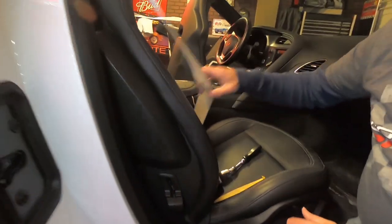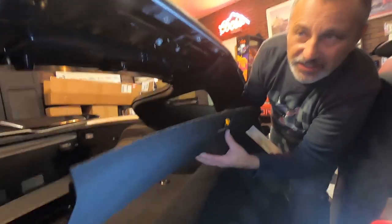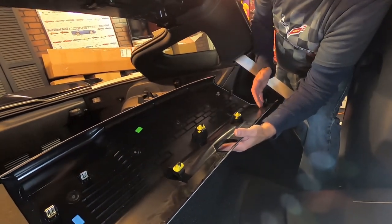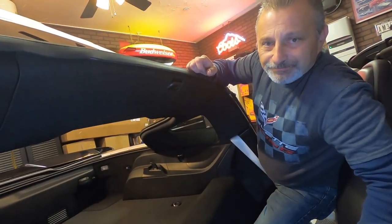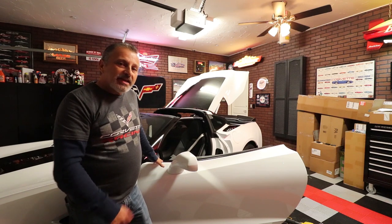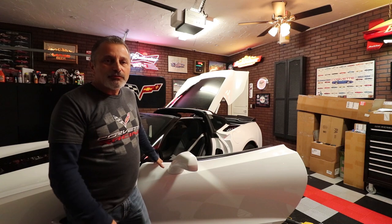That looks awesome! Now that we've got both seat belts in and all our trim done, everything is finished except for the center halo. We just need to snap that back in place — you've got two clips in the back, two on the other side, and a total of five clips in the front. Pop it right up where it belongs, make sure your rubber is not getting pinched, and we're done. Hopefully you found this video helpful and informative. When it comes time to put new seat belts in your C7, you'll have no problems doing it. Thanks for watching — if you haven't subscribed already, please hit that subscribe button and bell so you'll be notified of our next uploads.